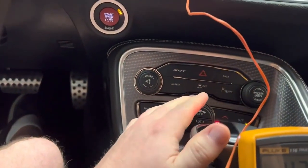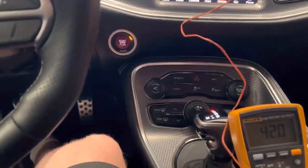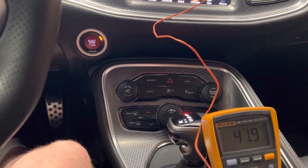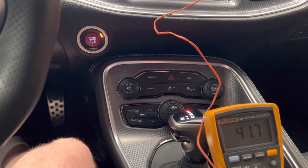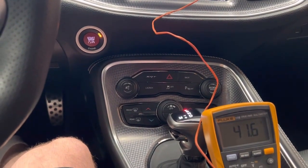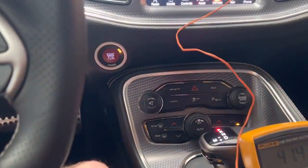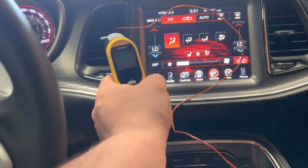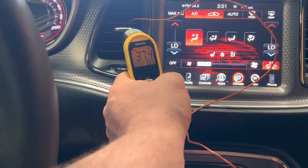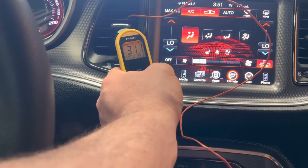Just to explain to you — your AC can't actually get any colder than 37 degrees, because if the cabin evaporator gets to 37 or less, your evaporator will freeze over with ice and then no air will actually pass through the evaporator, so you won't have any cabin cooling at all. So whenever somebody shows you temperatures with a laser gun like this, it's completely inaccurate and it's not that temperature.